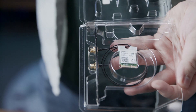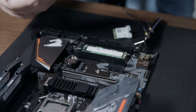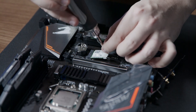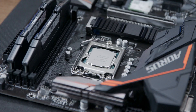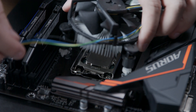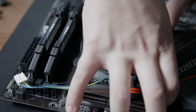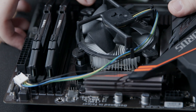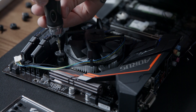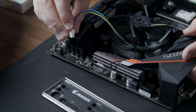The small wireless module will be installed the same way. Next we'll install our CPU cooler. Orient the cooler so that the fan connector faces the top of the board, then line up the four retention mechanisms on the bottom of the cooler to the four holes in the motherboard. Then firmly press down on each of the corners to lock it into place. Tighten each corner by twisting it as shown by the arrow on each retention mechanism, and then plug the cooler into the port on the motherboard.